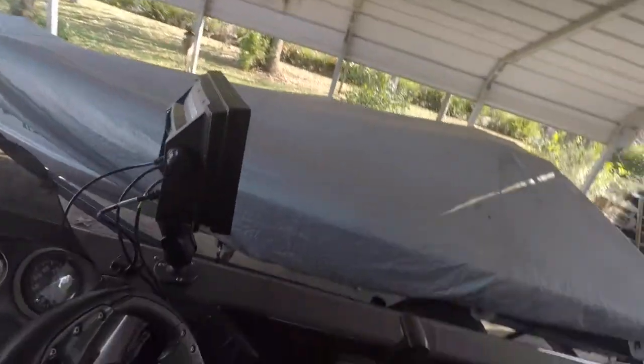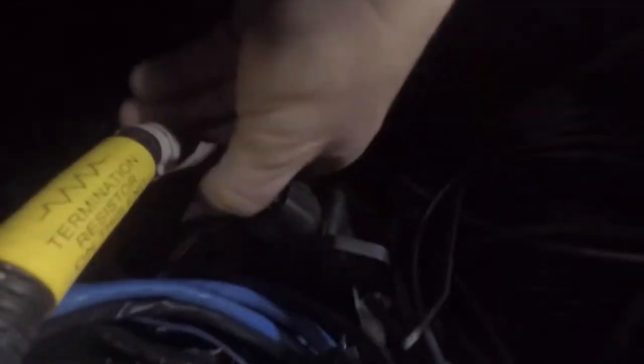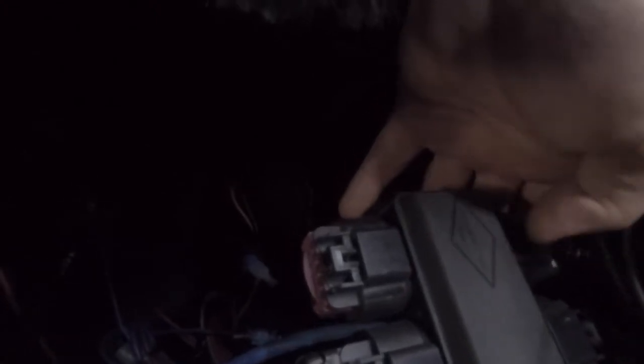I'm doing this video because there was not a lot of information out there. Mercury has this four-way junction box. Coming from the motor it comes in here — it's basically a four-way junction. This goes up to SmartCraft, to the ignition switch, and then you buy a gateway. There's a terminator on this end; you've got to terminate the data.